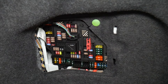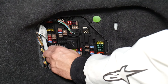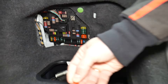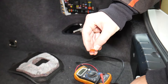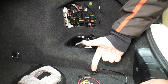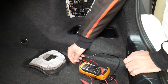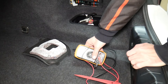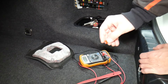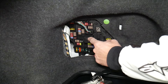Before we continue, let's explain why it's always a good idea to test fuses and relays. Fuses are sometimes really hard to tell if they're burned or not. I'll pull one fuse here — sometimes you cannot clearly see if it's good or bad. If you think you have a good fuse, put it back in, and you still have problems, you end up spending money on parts and diagnostics and services that you don't need. So always test your fuses even if you think they're good — it's happened to us too.